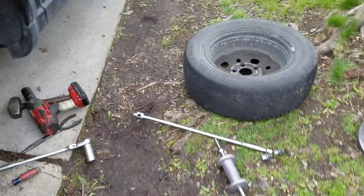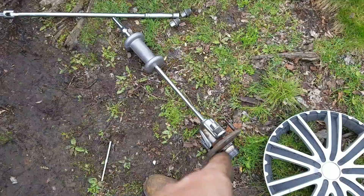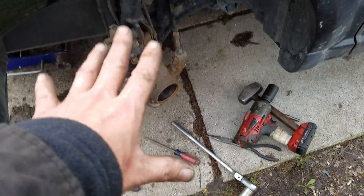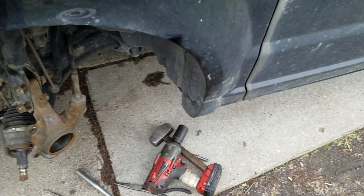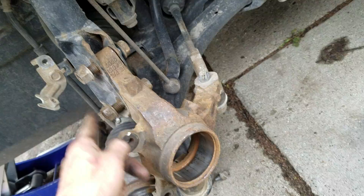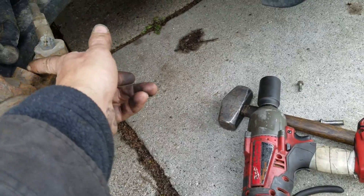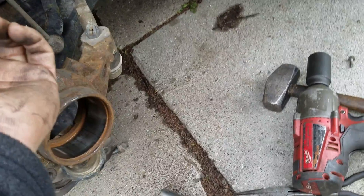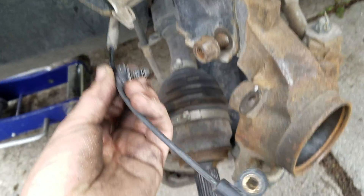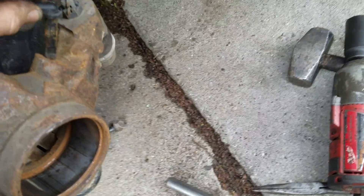Tools you will need. This is the way I do things. I do wheel bearings different than most people - I don't use the Arbor Press. Slide hammer to get the hub out, which is some work. 32 millimeter nut off the axle, 21 millimeter here, 21 millimeter here, 13 millimeter for your wheel sensor, 10 millimeter right here. Getting this out, you need a little cat's paw to pop out the little brake line - it has a little clip barbed end, although this one wasn't installed on this side and the other one broke off when I did the other side.